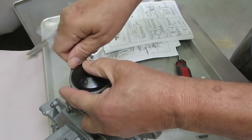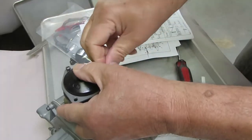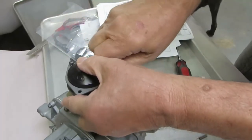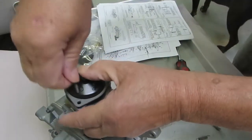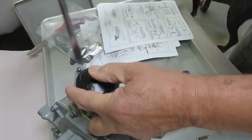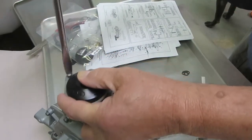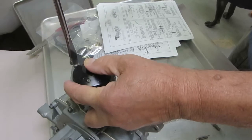So there we're going to put the screws in it. Right where my thumb is is where the hot air line goes into — heats up the choke. There's a vacuum port inside the housing where it helps pull in the hot air.